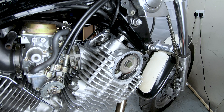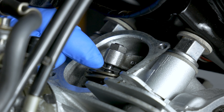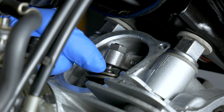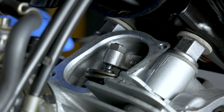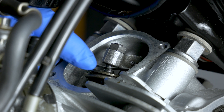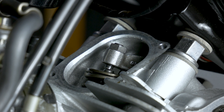So to adjust it — well, we're going to check it first. I'm going to put the 0.07 into the intake. I'm on this side so you can clearly see what I'm doing. The 0.07 is not going in. So I think my intake was a little bit too tight. I try the 0.08 — no chance, I can't put the 0.08 in either.